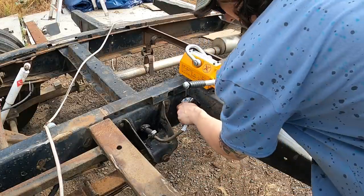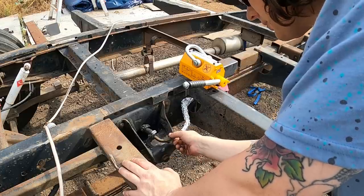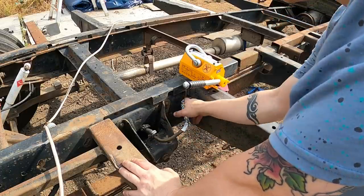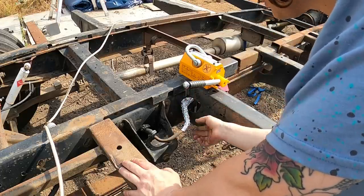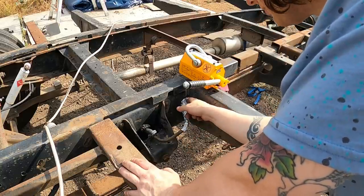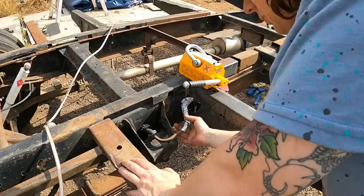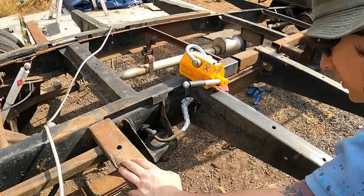A little tinfoil on that fuel line just to prevent any slag from sticking to it or even causing damage. That would be really bad. Tinfoil kind of just vaporizes when molten metal hits it, but I've put on a few layers. It's crinkled up, and if nothing else, it'll give any slag or molten metal time to cool down before it hits the pipe. But there's a few layers on there. I don't think anything will get through that. But just one layer just kind of vaporizes. So we've wrapped that up pretty good.